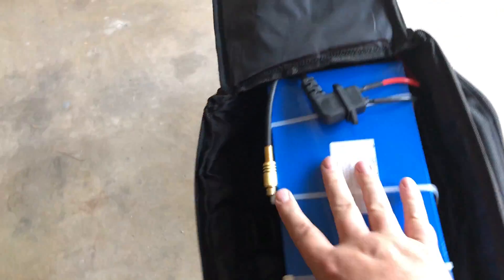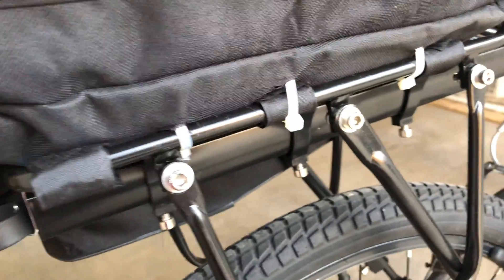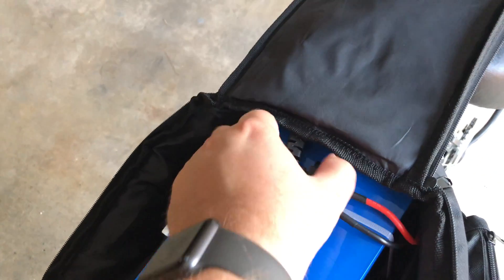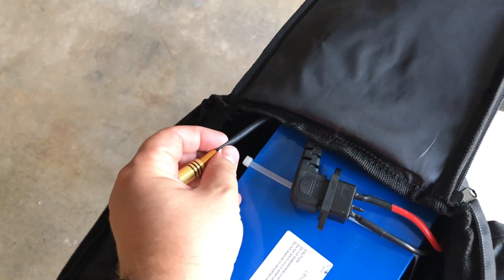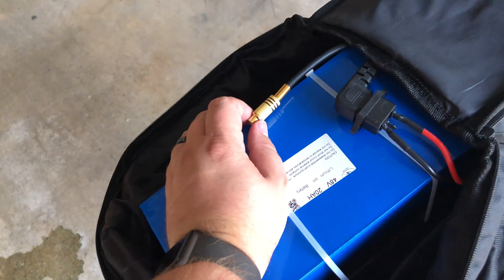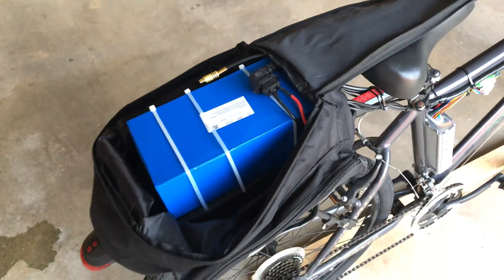I zip-tied the battery down — this one needs to be tight, and I have a few more zip ties to do. I zip-tied it down by puncturing holes through the case and strapping it onto the rack. This is the charging port, which actually looks like an audio unit, and this is how you plug in the battery. I just leave that plugged in, and then at night I charge the battery. It does take about 10 hours to charge, which seems a bit excessive, but when I bought the battery they said that would be the best way to extend battery life — by a slower charge. So it takes about 10 hours.